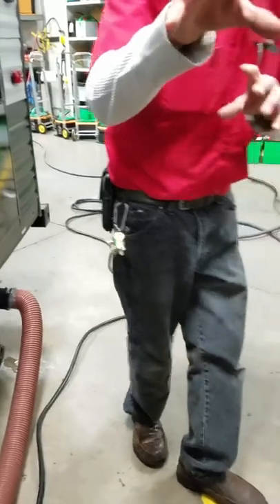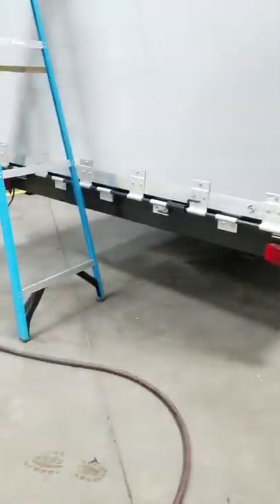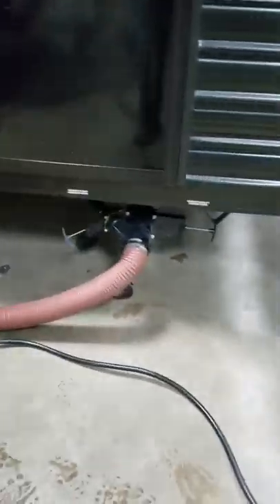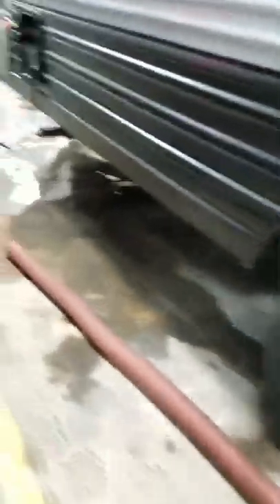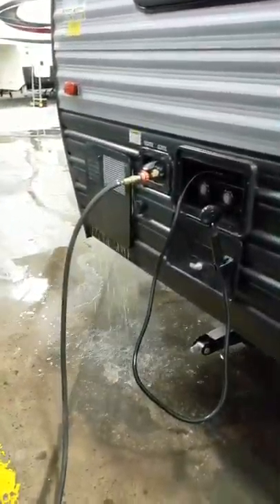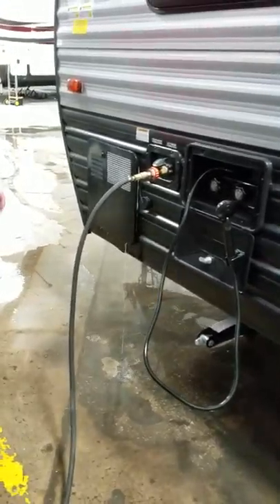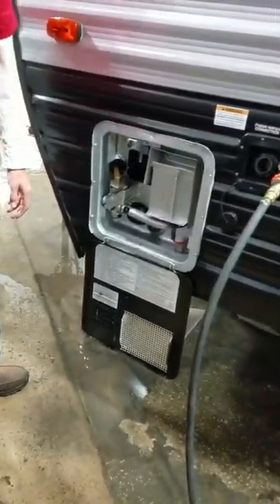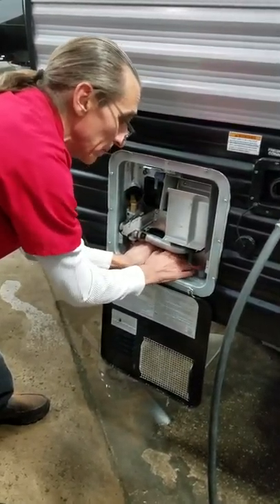Now theoretically, that's all we really need to do to that, but I'm going to blow it out because I can. And do you leave that anode rod out like that too? Oh, you wouldn't leave it open normally. That antifreeze that's going to go in there — I'll just go ahead and close it. That little bit of antifreeze going down in there won't hurt a thing; it has plenty of room to go. Now I'm going to blow this water heater out the rest of the way. That water heater is not bypassed — it's still open. The only time you have to bypass this water heater is if you're going to run RV antifreeze through it. We're not doing that right now.